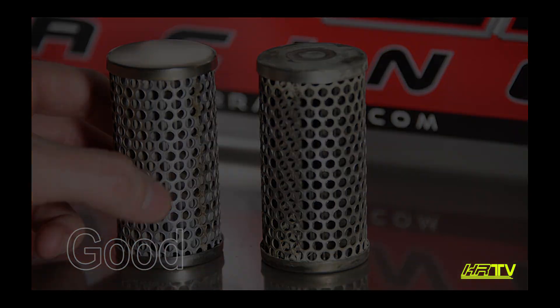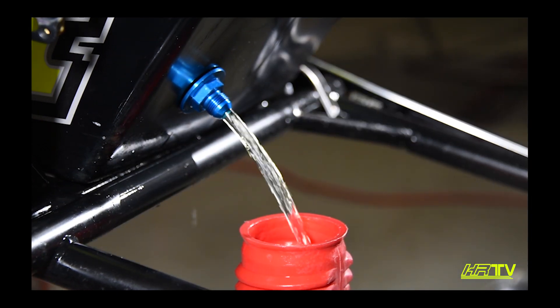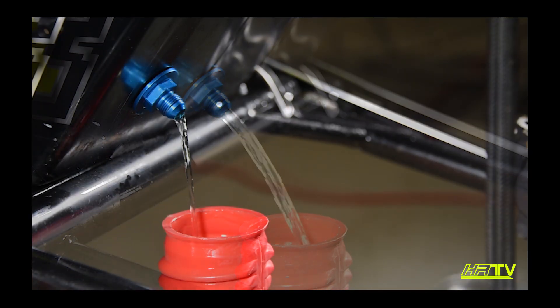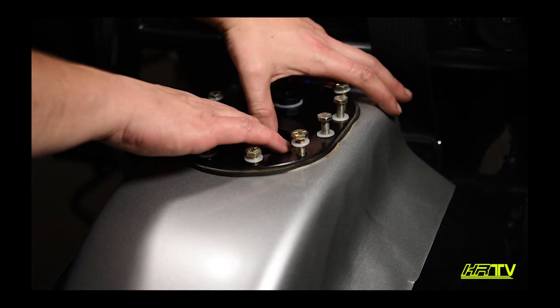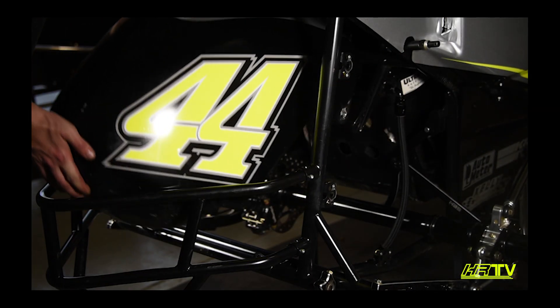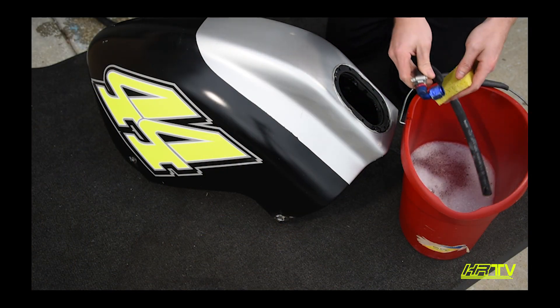Here is the best way to save yourself a lot of headaches and a lot of money when storing your car for the off season. First, remove the fuel line from the outlet bulkhead of the tank tail. Drain all the fuel out of the tank tail and dispose of it, or put it in a tightly sealed container in a dark location to keep the methanol from acquiring moisture. Take the cap assembly off, remove the fuel cell from the car, and wash it and the pickup tube with mild soap and water.